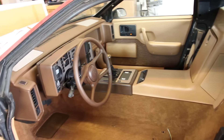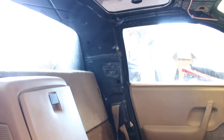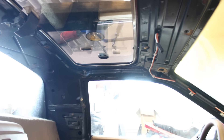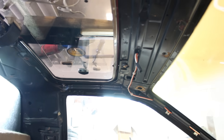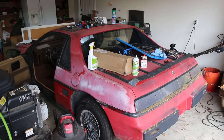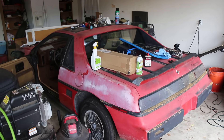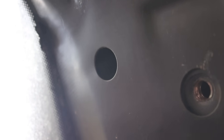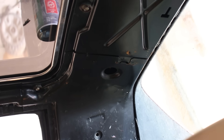The interior looks immaculate, but also not complete. The rear trim, A-pillar trim, headliner, visors, and everything else aren't in and aren't going to be in just yet. I don't want to risk damaging the new headliner when I use the wire tool to take out the front glass when it's eventually replaced. Also, I have to remove the sail panel and the entire rear clip of the car during the bodywork stage, and I need access to the bolts that the interior panels would otherwise cover up. It's best to keep everything off for now so I won't have to repeat all the work later.